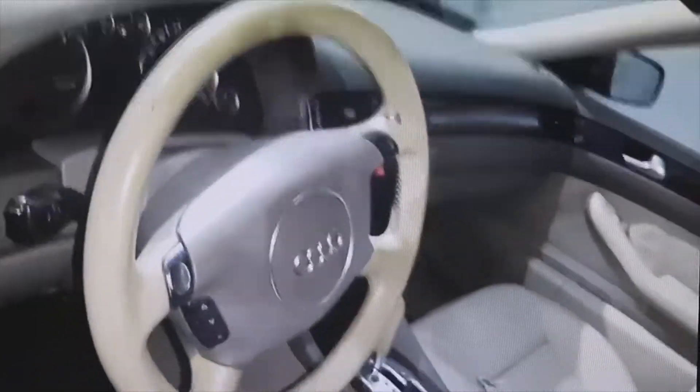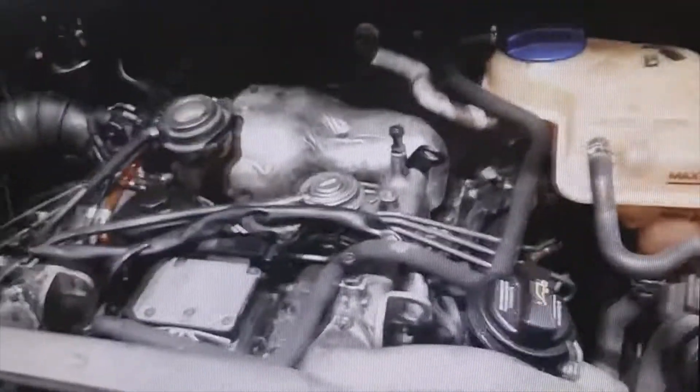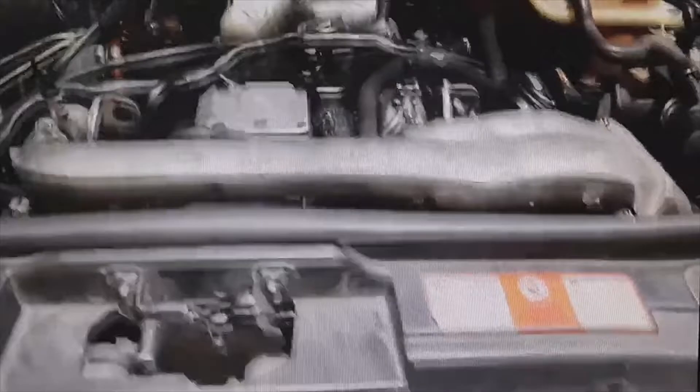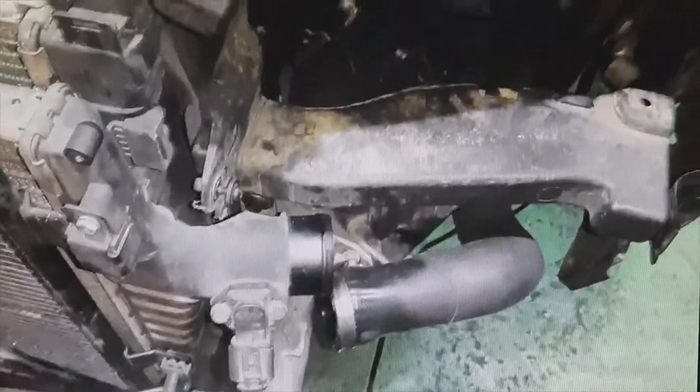Changing it is almost as expensive as the value of the sensor itself, because in this vehicle, to access it, you have to remove the front bumper. Look where it is located — there you will see it. This is the sensor; it has a 4-cable connector, which gives us 2 measurements: the air pressure in the intake, and also the temperature of that air.